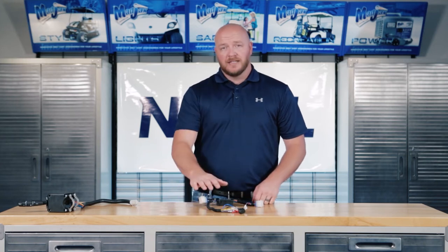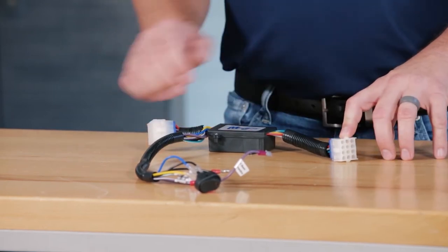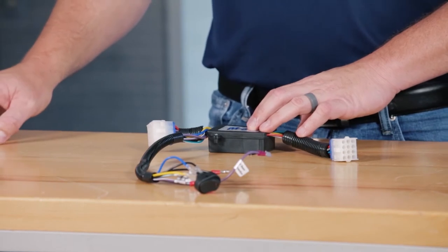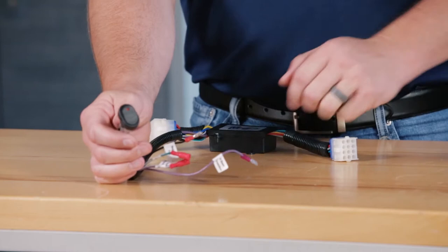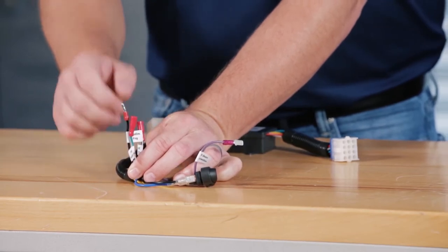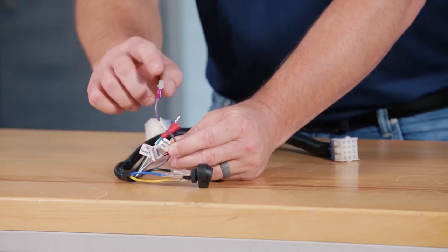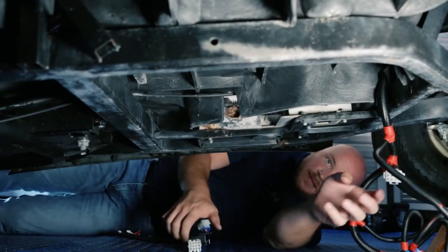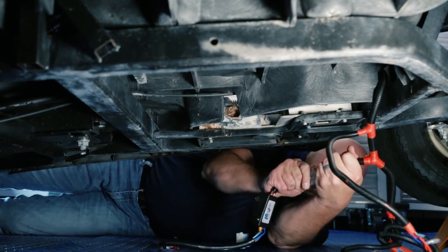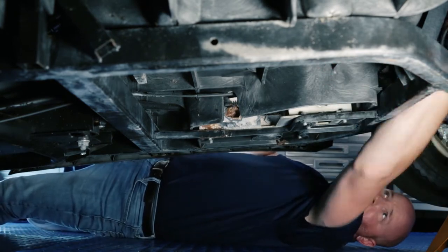Before we attach our relay harness, I want to go through the connections for you. You'll notice two 12 pin connectors on each side. The 12 pin connector that's over here by itself will go to the new light kit harness. The 12 pin on the opposite side will go to your indicator. You'll also notice you have a new hazard switch here, and two female bullet connectors and a male bullet connector — this is for fog lights or LED light bars on the auxiliary switch for your indicator. You'll also see a purple wire. This wire will attach to your new light kit harness. You're going to plug in the long end of the relay harness to your new light harness. Now we're going to push the front of the harness up into the dash cavity. We'll come back to this later.